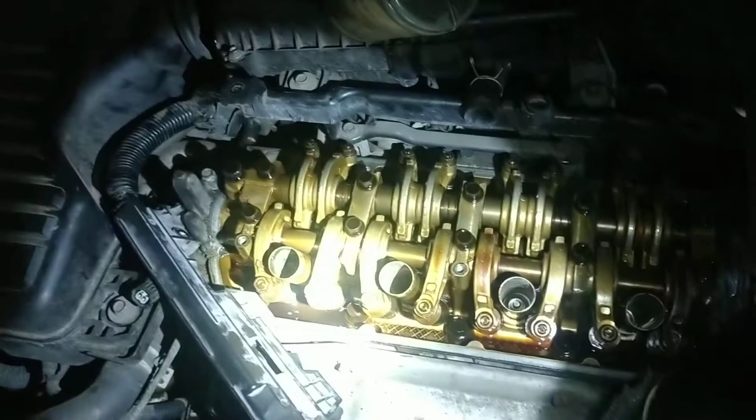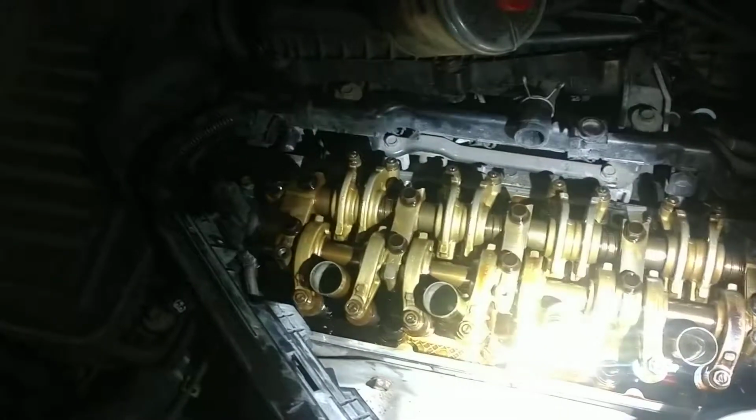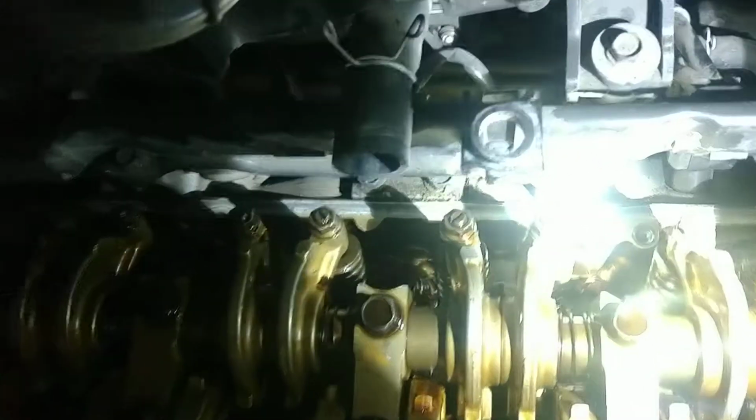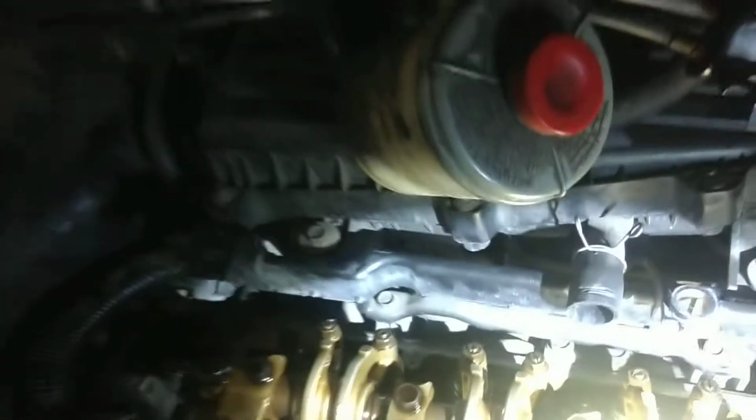You're also going to need to be undoing your valve cover. Five 10mm nuts hold it on top. Four 10mm nuts hold in your spark plug coils. Take out the nuts on all of those. You undo the 2 extra nuts that sit on these guys, 10mm as well. Those come out, you pop those up off the valve cover, and the valve cover should come off. Granted, it was probably stuck with the RTV that's on there, so you're going to have to pry on it to get it to come up. You'll also, in the process, disconnect this hose. It just came off automatically when I pulled up on it.